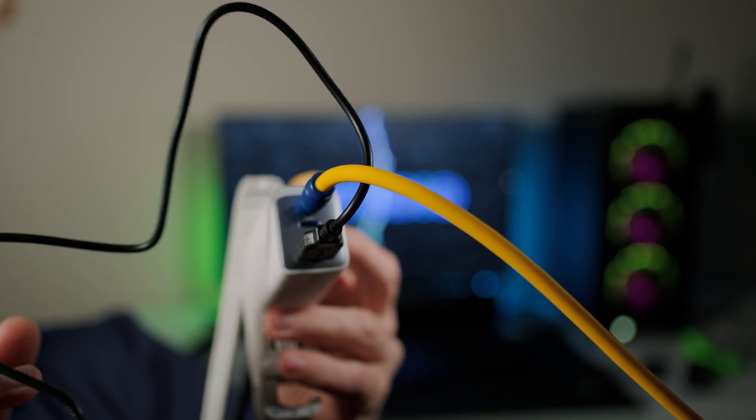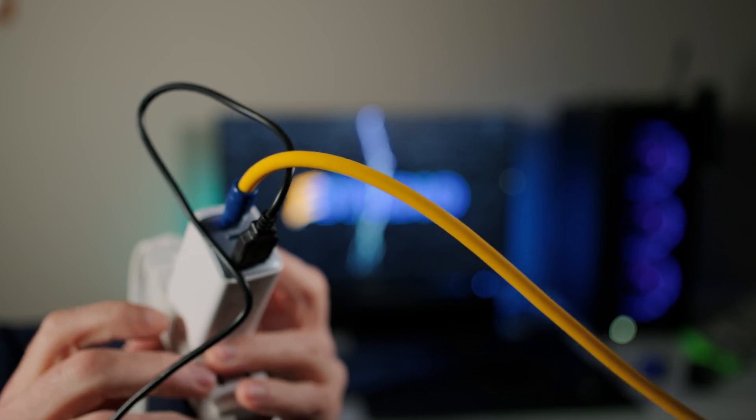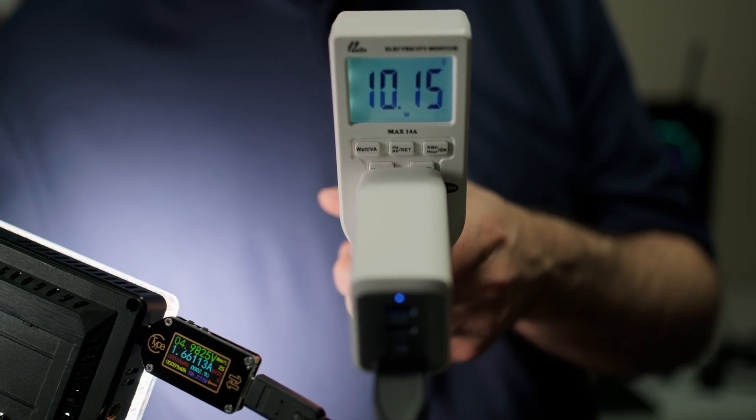Right now my dummy battery for my camera is powered with this USB cable, and the other one goes to my light. While disconnecting and connecting devices, it will flick on and off my camera and do the same to my light. So make sure if you use this in a studio environment, set everything first — I recommend quick charge set first, then your light if it's power delivery. It is now running 45 watts. The camera itself draws about 15 watts of power, or precisely 3.1 amps, slightly over 15 watts.